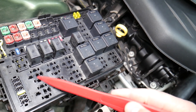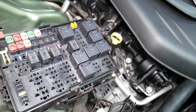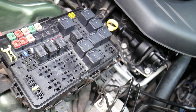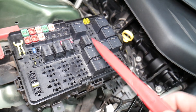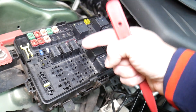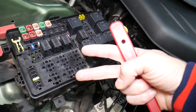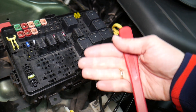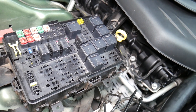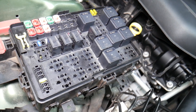For some fuses it's important to disconnect the car battery when removing them, otherwise you can burn electronics. When working on airbag fuses, wait at least one hour after disconnecting the battery, and if you're not qualified to work on the airbag system, I would never recommend doing that. Also, a common mistake people make is not knowing which battery terminal to disconnect and reconnect first. If you do it the wrong way you can burn electronics modules — we burned a traction control module on a BMW that cost two thousand dollars. We'll put a link in the description on which terminal to disconnect first.